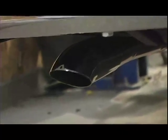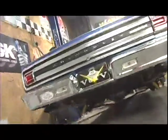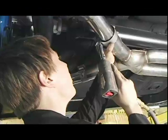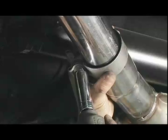You're not quite finished yet, because invariably there's going to be some little leak somewhere. So before the system gets too hot, crawl under the car and put your hand around each of the seams and clamps — you might discover one is puffing a little exhaust pressure out. If that's the case, loosen it up, move the clamp a little bit, tighten up that leak, and crank everything down. We tend to use a little bit of anti-seize on all the clamps so the bolts squeeze down cleanly and don't gall or bind, which makes for a really slick system. And be prepared to get involved in conversations at the cruise night and parking lots, because everybody wants to know what it is.